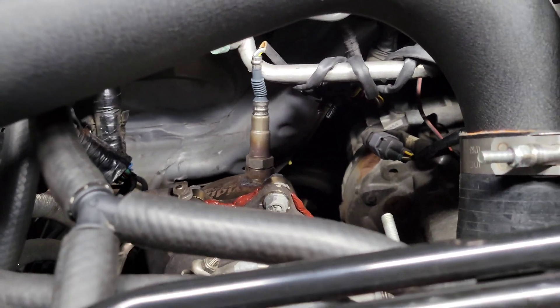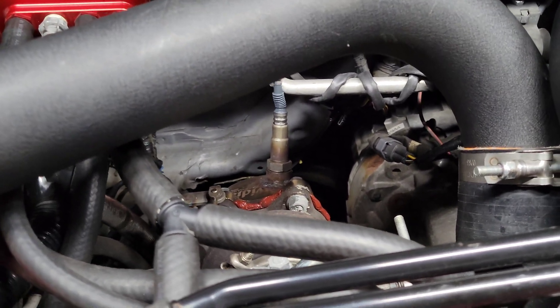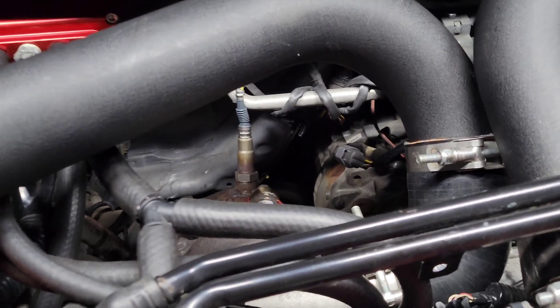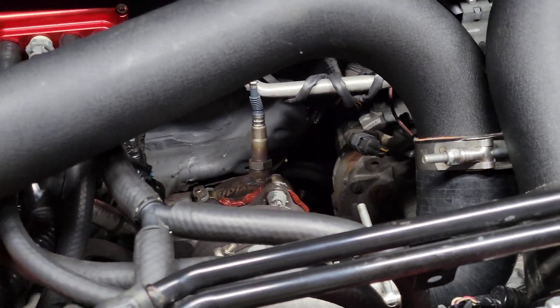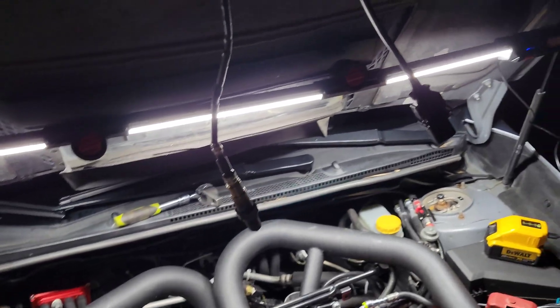My apologies — I need to calibrate this O2 sensor to the Innovate ECF-1 gauge. What that consists of is disconnecting the sensor and then letting the gauge run for 30 seconds until it reads O2 error. Also, you need to disconnect the O2 sensor to have free air so it's not connected to the exhaust. Now that I have the O2 sensor disconnected, I'm leaving it hanging right here because it's a little warm.